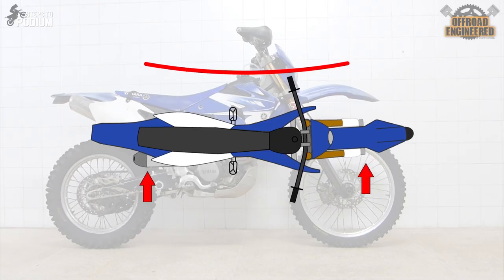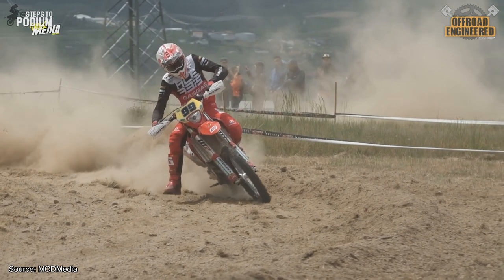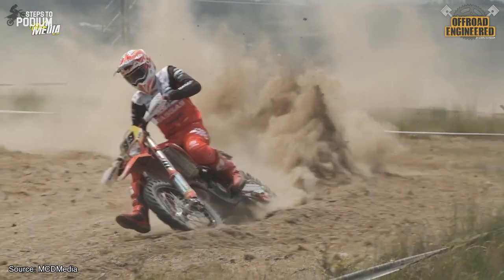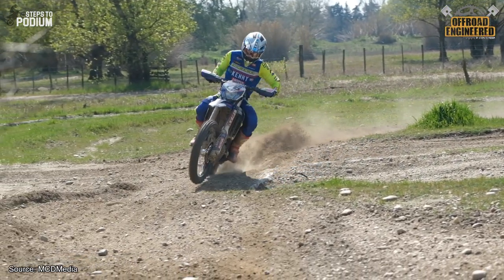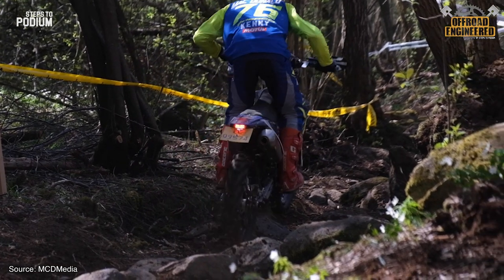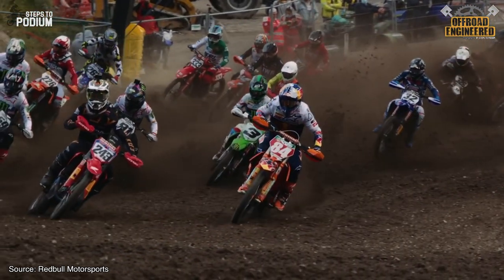The lateral stiffness isn't as simple as the other two. Lateral stiffness affects the way the frame flexes from side to side, like in a foldable bicycle, and has a huge impact on how comfortable and stable a bike feels while cornering, since there's no suspension travel available to absorb the bumps. A frame with really high lateral stiffness suits motocross and supercross since the dirt is relatively even, while less lateral stiffness suits off-road, where the frame's elastic properties help absorb small rocks and roots, keeping the wheels planted. For supercross, the rider might lose some feeling from the wheels since the frame will absorb part of the inputs.